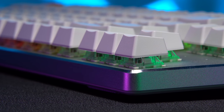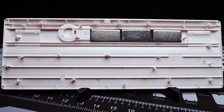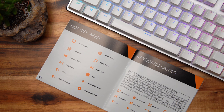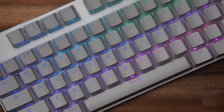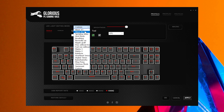The stock board actually sounds pretty solid to me — not that I'd hold it to the same level as a custom chassis, but it sounds better than Drop's latest entry-level board and better than the Keychron K8. Also inside the case are three large weights that serve no purpose other than to give the board heft and make it feel more substantial. In terms of layers and features, there are a few basic hotkeys and shortcuts — no QMK or Vial support. Really standard stuff like media keys and lighting controls. If you want to do custom per-key lighting, you'll need to use their software, which is super basic with support for three profiles, lighting selection, and a macro editor.